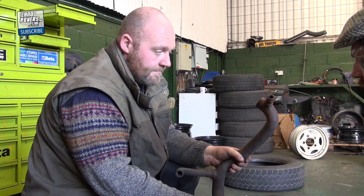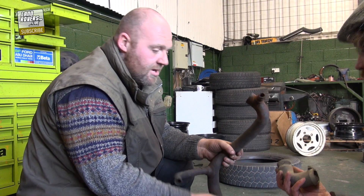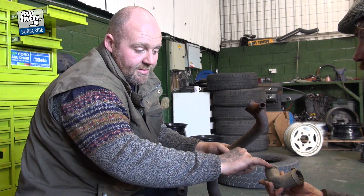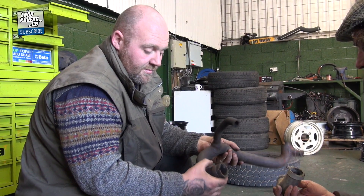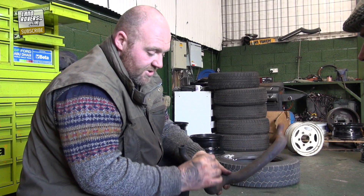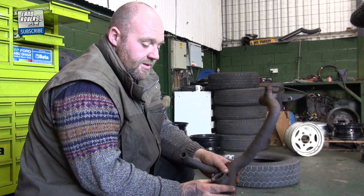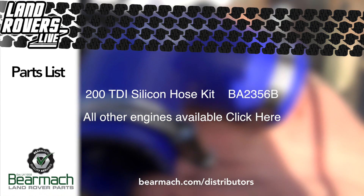What other things would we be looking for on our pipes? Where the jubilee clips are going — any splits towards the edges that could go underneath the jubilee clip, or any splits around where it sits. You can see where it's gone in there, where it's been under that much pressure. They just generally wear and tear and split. Would you recommend changing these pipes? Yeah, I'd just recommend changing them — new pipes, new coolant, new everything. So we've drained all the water out of the system. The next job is to get our new silicon hoses fitted, and the part numbers will be on screen — available from BearMac.